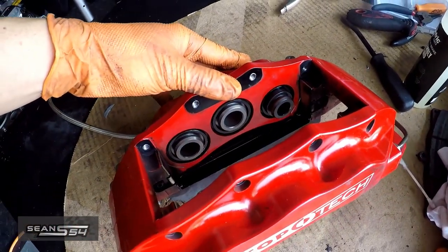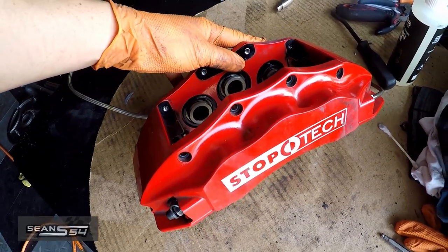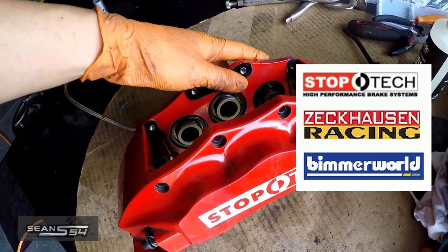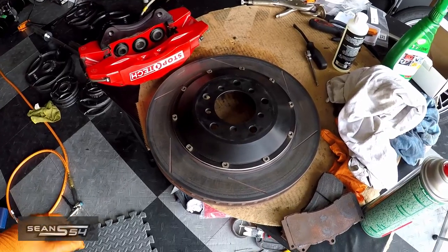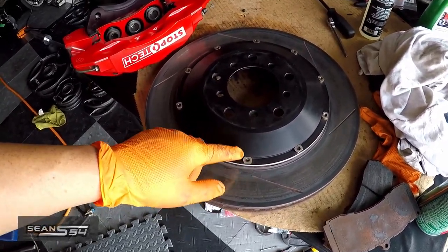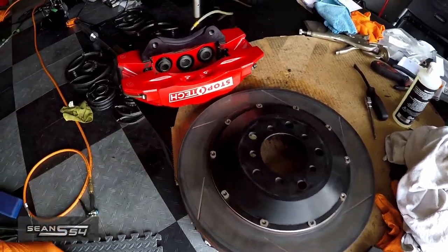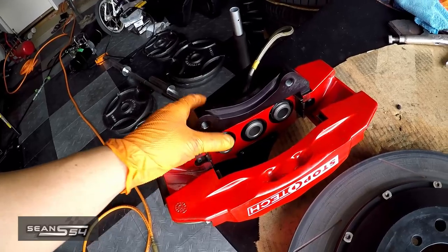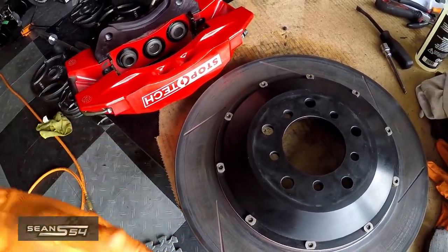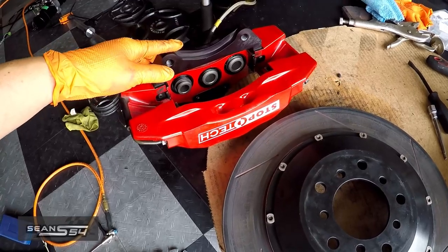This side is pretty much done. I'm going to bolt it all up, bleed the brakes, and make sure there are no leaks. For your setup, I recommend doing your research and reaching out to your big brake kit manufacturer as well as Zeckhausen Racing and Bimmerworld to see what's best for you. To recap, the downside of making the rotors fully float is potential noise on the street and potential hammering of the rotor hats, making them not last as long. The downside of the anti-knockback springs is that your brakes will always kind of push out and square up on the rotors, so brake pads and rotors might not last as long — both downsides if it's a street car. But because this is a dedicated track car, I don't care about the noise or my brake pads scrubbing the rotors a little bit.